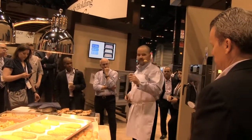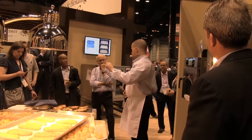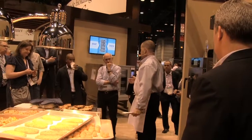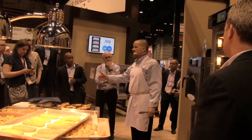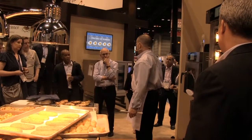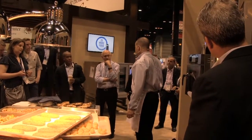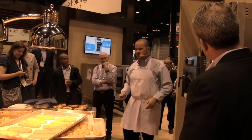And to take it one step further, we add that immediately when you close the door, not at the end. Because if you're talking about an 8-minute cook and it adds 5 seconds, now that cook is going to end at 8:05. And as much as I like to talk to my customers, I know that it's going to create a lot of phone calls, because their oven's not technically broken, but they're going to say, my oven's cooking too long, something's wrong. So we actually add it right when the door closes. Nobody's going to notice it now.